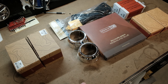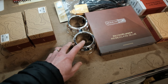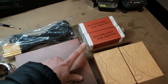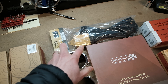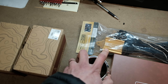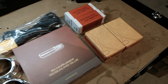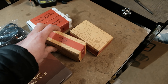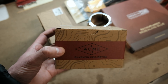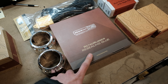The kit from the Retrofit Source is going to come with everything that you need to complete this job. You will have some options to choose from, such as your shrouds — what style you want. You can choose to add in halos if you want as well. You'll get to choose the color temperature of your bulbs. And then there is a selection for the relay or the wiring harness. This is H4 on this model of Tacoma, so we got the Moto Control wiring harness, which will help us install this into the Tacoma. You'll also get your speedy start ballasts, and then the projector unit itself, which has the cutoff all built into it. You can also choose to add resealing glue, like I have, as a precautionary measure.